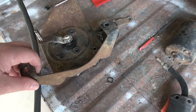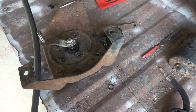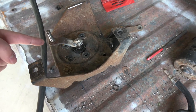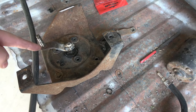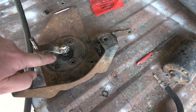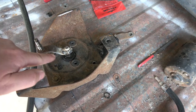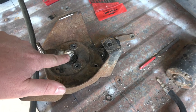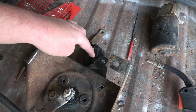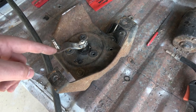All right, guys, so I've pulled the motor back out. I've welded the, for me, whew, that's hot. Don't touch that, stupid. So for me, this arm right here needed to be as far out on that shaft as possible. I had two choices. I could either weld this to the shaft, and I thought, man, that's great, except for if this motor ever goes out, then I'd have to buy one of these also in order to re-rig this whole thing up.